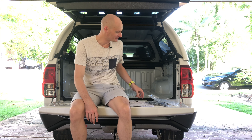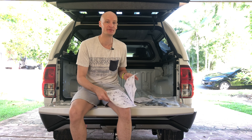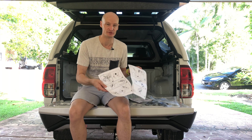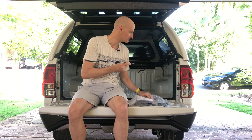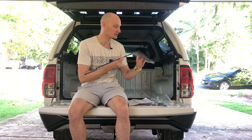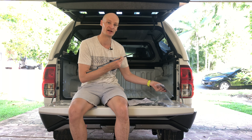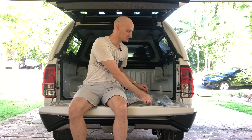The most important thing you can do before undertaking any installation is making sure you read the instructions so you know precisely what is required. I've read through these, which are a little bit — there's a little bit of guesswork involved because there is no text, it's all just purely via pictures. Basically there's two components to this. One component is installing essentially this bar, which takes the weight of the tailgate, and has a plate that you install in the hinge section, which takes the weight as the tailgate goes down — because just attaching it straight to the tailgate wouldn't be enough to support it due to the weight. The second part is the installation of the gas strut itself.